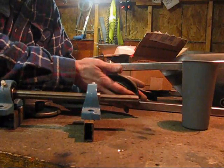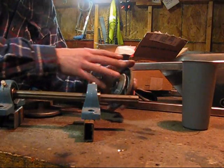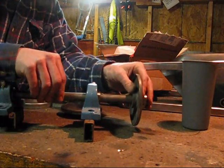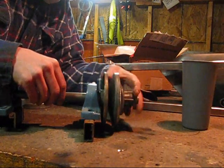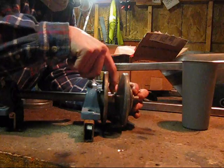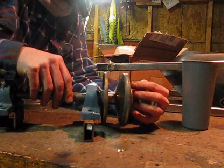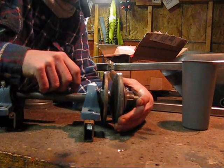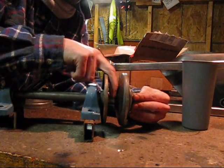Torque converters — if you've ever looked at the case of a torque converter when you buy it, they've got these vents cut into it so that air can flow past the torque converter itself. When you've got it all put together, you have this insert right here and your bronze fitting right here. When you're going, the weights expand and push this in, it squeezes the belt and causes the belt to ride higher. When you decelerate and take your hand off the accelerator, the pressure of the belt moves this thing right back into place.